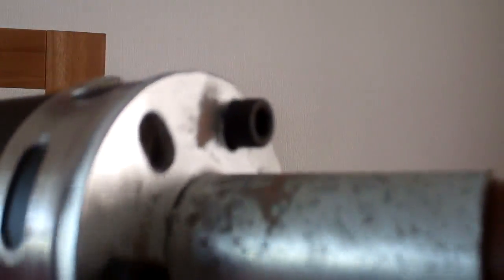Here we go, 22mm copper pipe. That'll fit in there. Like I said, stick some exhaust jointing compound on and a Jubilee clip round here. That will not come out. But these silencers, they're repackable, so they're a straight tube basically, but inside they've got wadding, so you can take them apart and clean your wadding if they get gummed up, but I've never had to do one yet. I fit these and forget them. They're a lot quieter than others, and they're really robust, they don't fall apart.